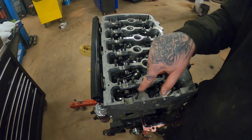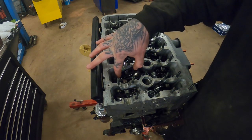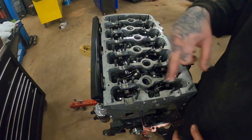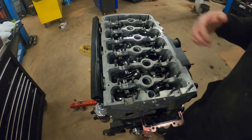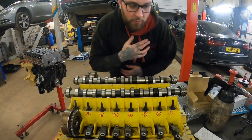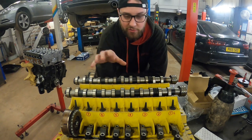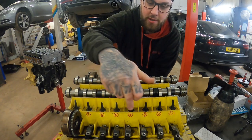So you've seen the double valve springs, I've shown how to clip the lifters back onto the rockers and how to put the rocker back in sitting on top of the valve. Do all of this before you drop your cams in. Now I'm going to show where I kept all my cams and caps - they're numbered because you need to put them back in the same place. We'll clean them down and start putting them in.